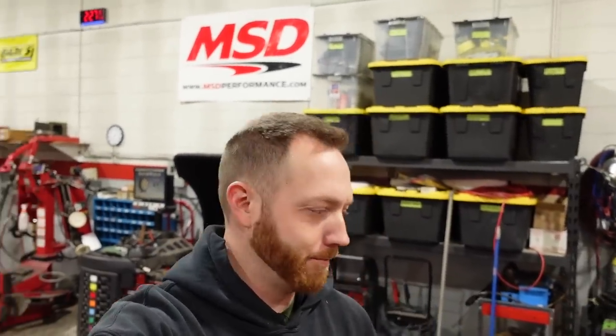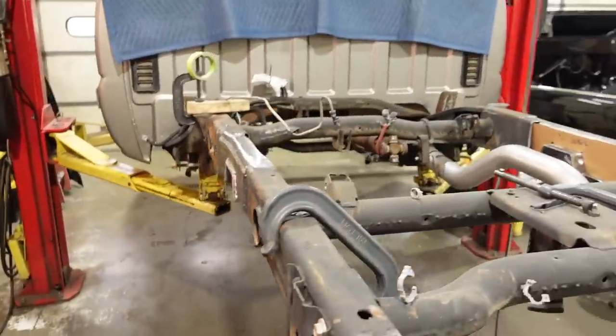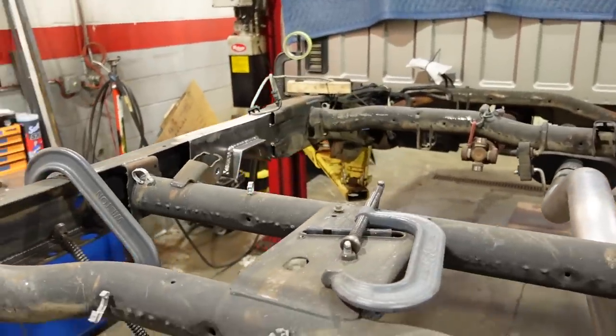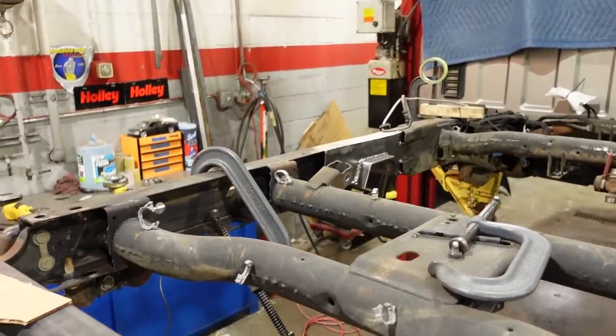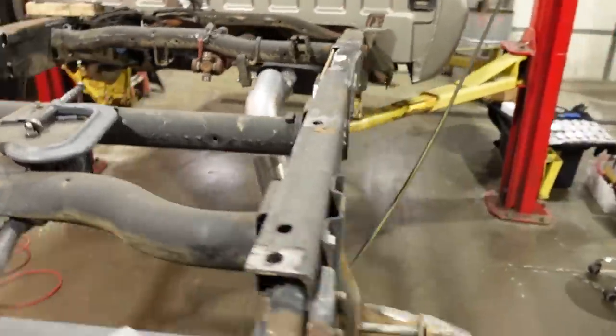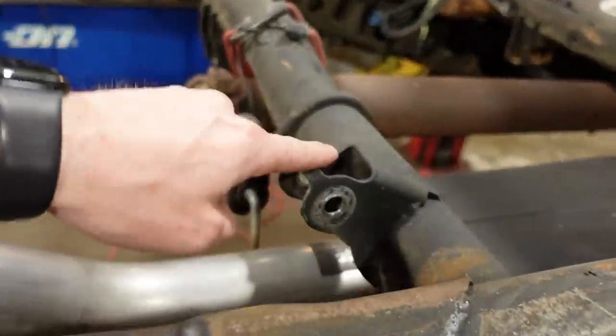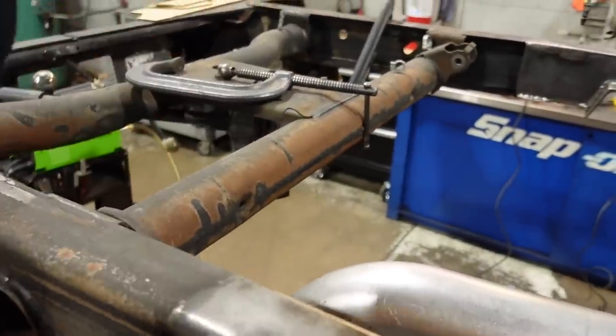All right, Friday afternoon, and we are almost done with this job. Running a business takes a lot of time. I used to be able to do YouTube 7 days a week, but here we are. Anyway, I have one side all patched up, reinforced, and nice and strong, boxed on the inside, fully welded, and ready to go. Now all I have to do is cut out the cardboard template for side number two, weld it in, chop a couple of brackets off here, weld a few more brackets on there, remove that one, and then the project is gonna be done for the day because it's Friday.